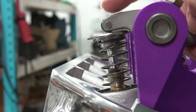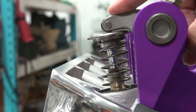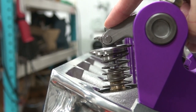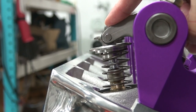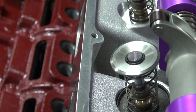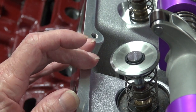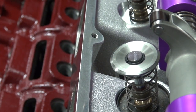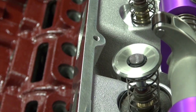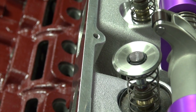It's worth checking though. The roller is a little bit on this side of the valve before it starts to open, and then you'll see it walk over a little - I think that looks pretty good, I'm not unhappy with that. There's our witness mark on the lash cap - not perfectly centered, but I'm not unhappy. In the next episode, hopefully the crankshaft balancer will be done and we're getting closer to final assembly.